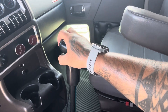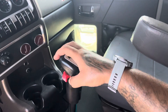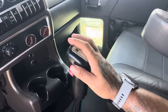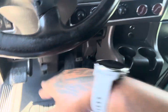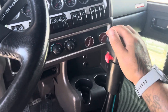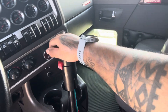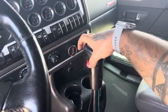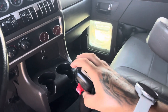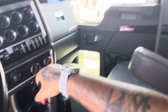If you want to downshift, it's just doing everything in reverse. So if you want to downshift, I'm going to go seven high. If I don't use the clutch, I'm going to hit the accelerator and push it up to seven high. Then I'm going to split it and go seven low. Then I'm going to go high, then back to six high, then six low. And that's how you downshift.